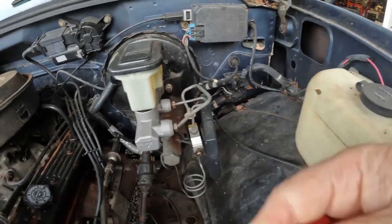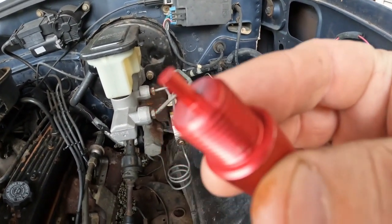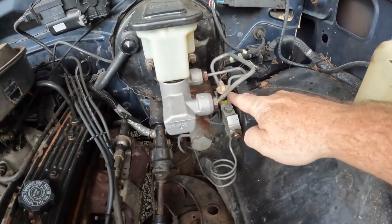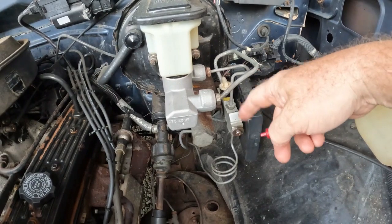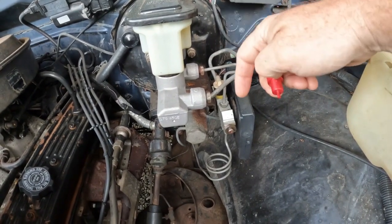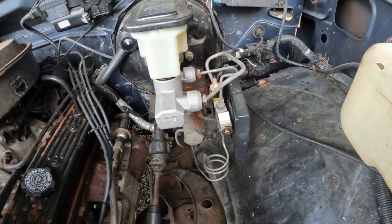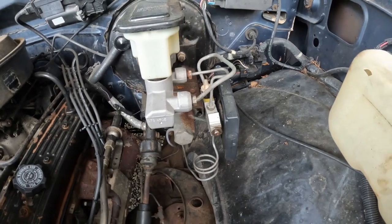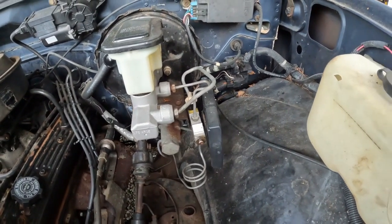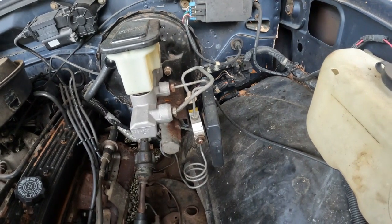So this little thing here — let me take the tip off of it. It's got a pin in it and threads, and when you screw that brake light switch out, there's a spool in there. You thread this in, and it should center that spool back up, and it'll hold that spool so you can bleed the brakes. That way it won't shift back and lock the brakes off every time you try to bleed it. That's what I'm going to try to do. I've got a bleeding kit — something new we're going to try out. Let's try to get this switch out of here first.